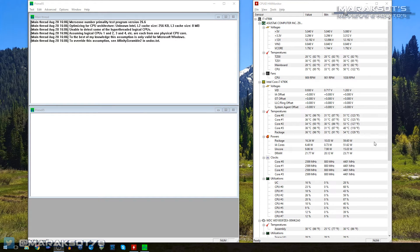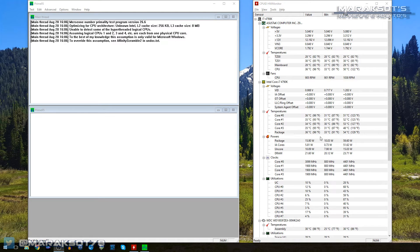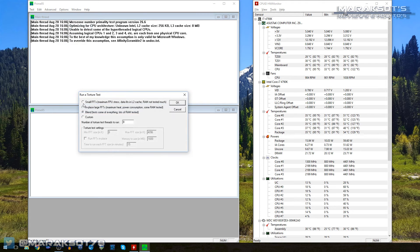We're back up and running again. You can see my core clocks are fluctuating all over the place, but that's because I've got OBS open to record — I don't have a capture card, so I just used live streaming software to capture it all. Our core temperatures are fluctuating in the mid-30s, and here's a screen capture of our previous test where we were in the upper-30s and into the low-40s. So it looks like our CPU temps have dropped by a few degrees with the Noctua paste. Ambient room temperature is about the same as before — right around 80 degrees Fahrenheit, around 27 degrees Celsius.